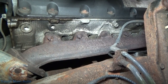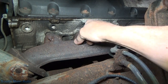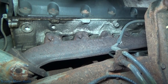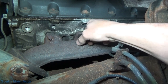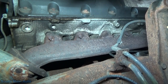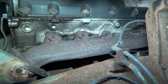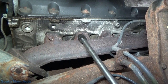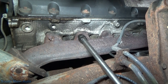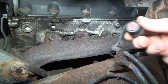Let's try these out and see if they bite. We'll go for the second bolt in — she's a virgin, hasn't been touched yet. We're going to grab the 12 millimeter one. That feels a little loose, so we're going to go with the 11 millimeter. I think she'll bite, but each time we go, she gets whittled down a tad more. Let's go with the 10. Yep, we're going to have to drive it home. Let me get the appropriate striking device — got an extension, little hammer, we'll give her a little tap. Let's stick it on a half-inch extension, very gingerly, tap it up on there. These typically come loose — I'll be honest with you. That one came loose there, fella. That is not what we planned. However, the flank did bite.